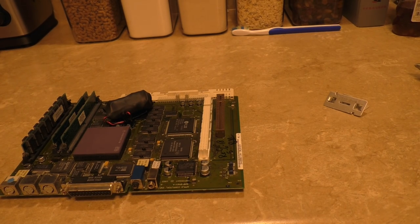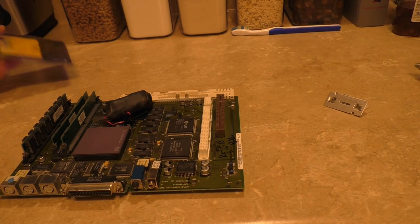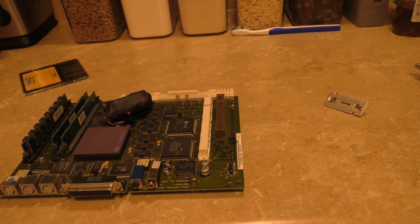I think one of the underlying points of this later series of videos that I've been making with these Macs is I'm trying to make sure to get the message across to people who own classic Macintoshes that weird problems can occur if your capacitors are going bad. In fact, it all started years ago with the Macintosh Classics and Classic 2s having nothing but problems, mostly related to the checkerboard pattern on startup.